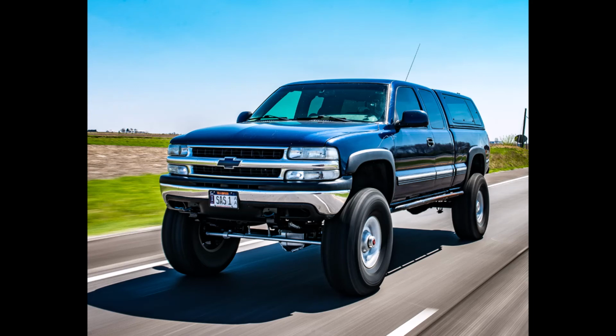Do you have a checklist of things that you check specifically after a long wheeling trip, or is it kind of general? I know the normal maintenance intervals. For a while, before I got the Yukon locking hubs, I was having issues with water getting in the hubs, so I'd pull those every single trip, make sure there's no water in them. If there was, I'd repack the bearings and all that stuff. I'd grease the tie rod ends and all the greasable joints every single time before I go on a wheeling trip, or sometimes after if I'm not planning on going on one in a while, especially since I drive in the winter.